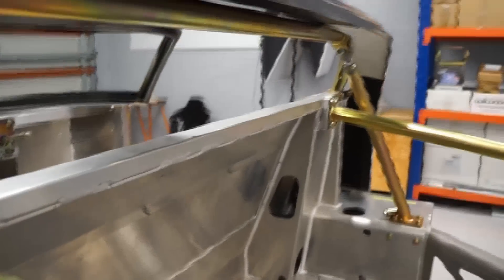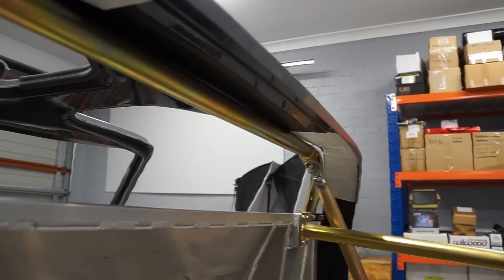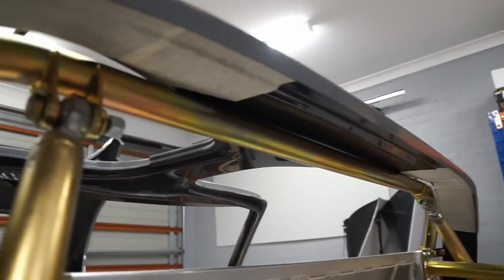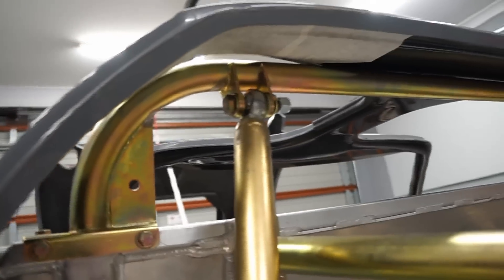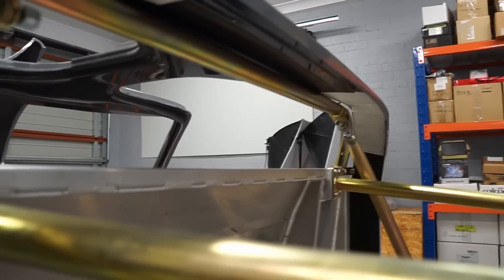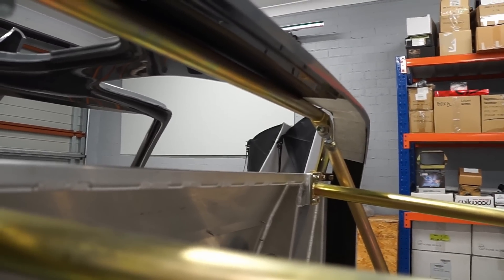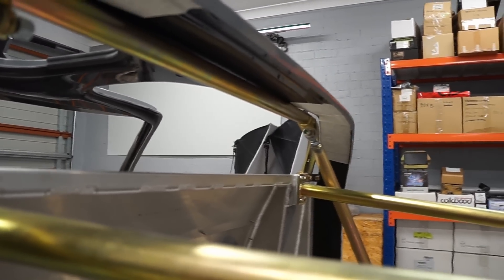If I come through to the back here and have a look under the spider, I've just put some paper tape — like a masking tape but a wider roll — and installed that on the inside because the gloss black panel was really hard to mark up and see what I need to cut. That's basically just so that I can use a pen or lead pencil and mark the extent of where I need to trim the inside panel.